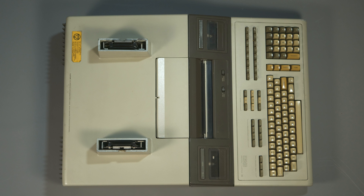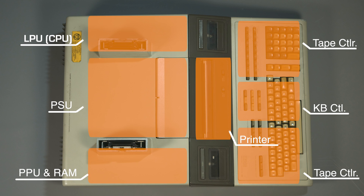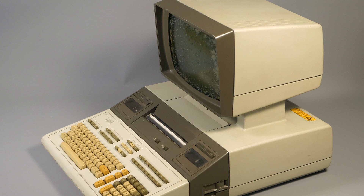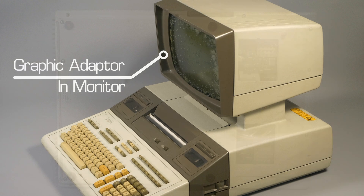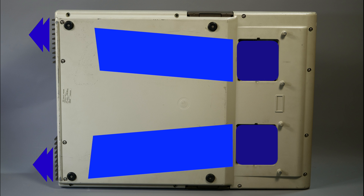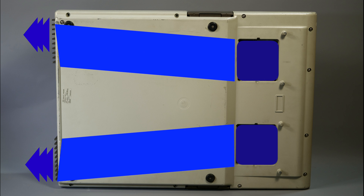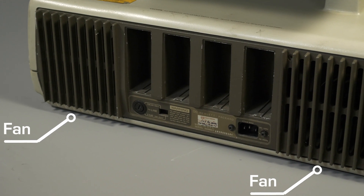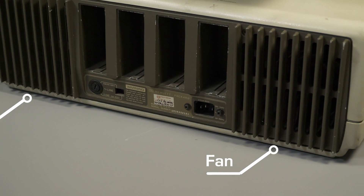Let's start with the story of the case itself — it's got a lot to pack in. There are tape drives, a printer, ROM drawers, two card cages, a pluggable bus, a big old power supply, and this is all topped off by a monitor with an embedded graphics controller. This machine is an example of careful thermal engineering. There are dual airflow channels, one through each side of the machine, and it does generate some heat. The tight packing of components led the mechanical engineer, Lee White, to do quite a lot of work on thermal and airflow studies, and yet it is also, at least for a fan-driven system from 1980, a quiet system.